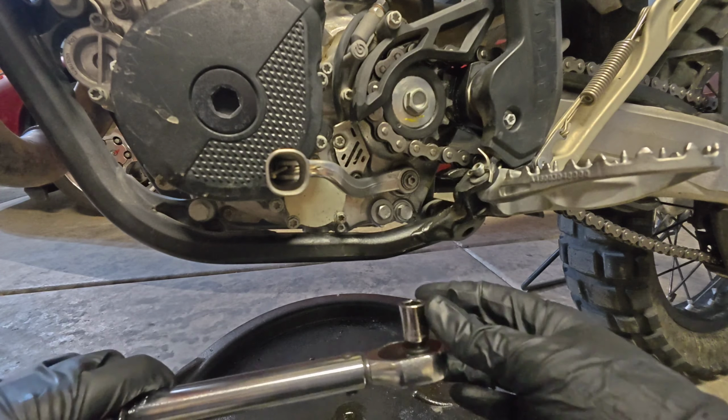It's good to inspect this to see if there's any damage. In my case, I actually went for an extended interval on my oil. So I'd be curious to see, for one, if there was any physical damage, any rips or tears, or two, where I rode the bike kind of hard, is there any metal shavings, anything like that? I think we're good. I'm gonna just set that down out of the way. And I'm gonna give this a few minutes to drain off.